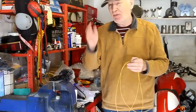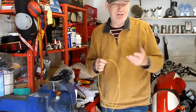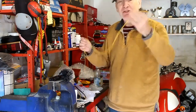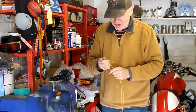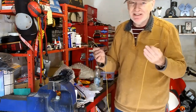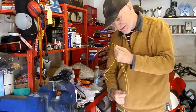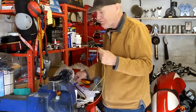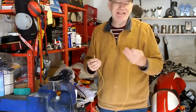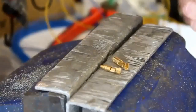While that paint's drying I can still make a start on the wiring. I've grabbed some suitable yellow wiring because I always use yellow for indicators. I've measured out roughly the length I need for the two rear indicators to go from there to the M unit - a bit over-long, but it's better to do it too long rather than too short. They're the same color because you can't really get it wrong with left and right indicators. I've already fitted one bullet connector which will go straight onto the existing connectors on the indicators and rear lamp - you don't want to be cutting off existing connectors unless you really have to.